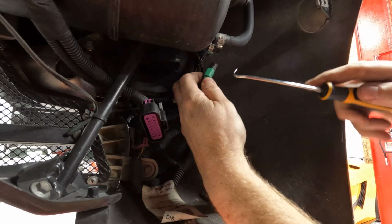So we unplug those and plug into the wiring harness, and then we can zip tie all that out of the way. We wanna make sure it's not in the way of the electronic parking brake, which is this guy. Then the other thing we're gonna have to do is connect some extensions to these hoses right here. These are the actual vacuum lines. We gotta run those down to the valves, which are right here, and make sure that those stay far away from the exhaust. We'll probably zip tie it to some of those hoses that you see on the transmission to keep them nice and far away. So that shouldn't be a big deal. All right, Forza is mounted up, zip tied out of the way, connected up, and the vacuum lines are run to the valve controllers. Okay, now I can put back on the bumper and button everything up.